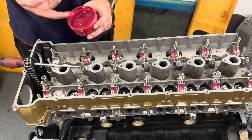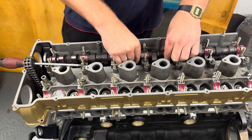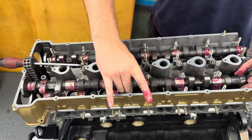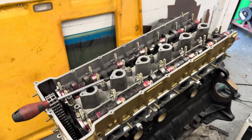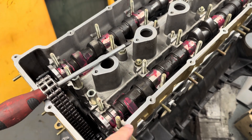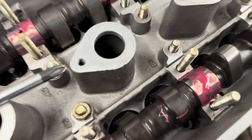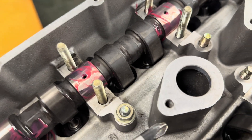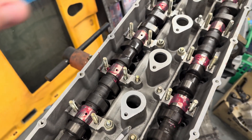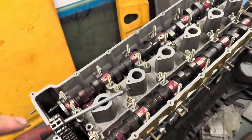However, my nifty plan of just installing the front two buckets with lighter springs doesn't work unfortunately. I didn't think about it, but the cam lobes hit the tops of the valves. So we're going to have to install all the buckets and shims and then tighten it fully down. I'm going to add all the rest of the bolts in, remove the cams, fit all the buckets, and then go from there.